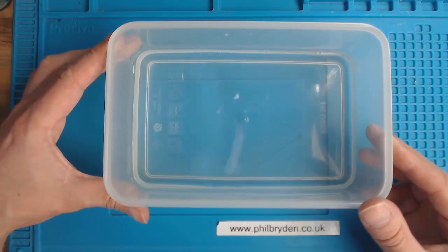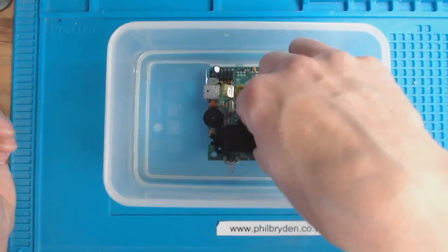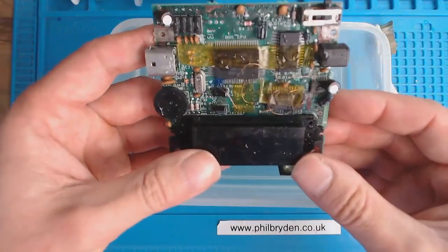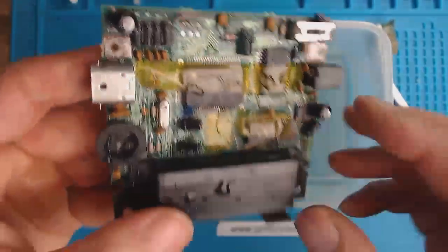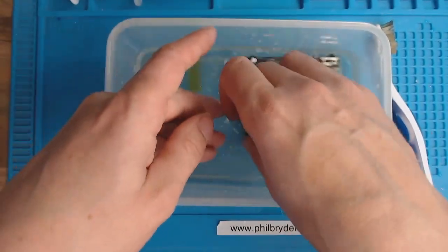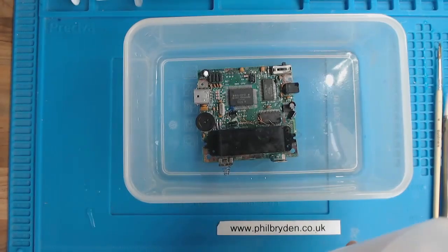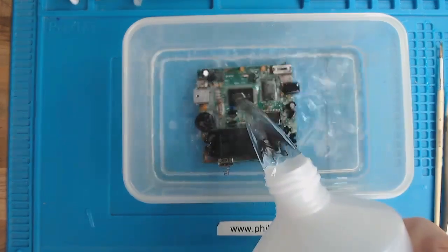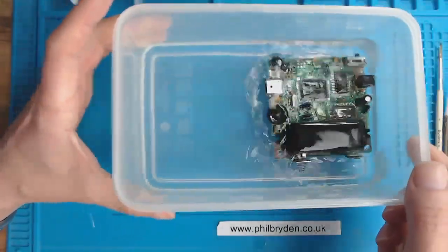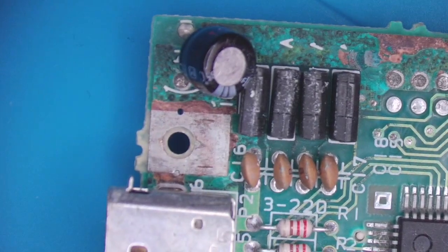So I've got some white vinegar and a very corroded Game Boy. What I'm going to do now is swap the vinegar over for some water with some bicarbonate of soda in. So that's the bicarb mix. This is the alcohol and that's going to get rid of the water. After a good soak this is what we end up with.